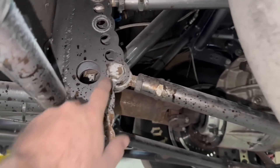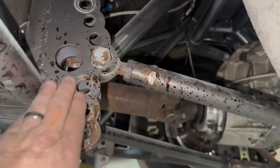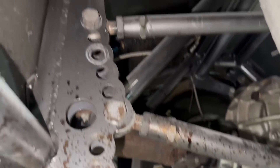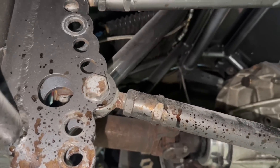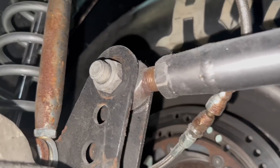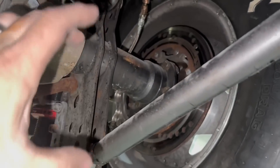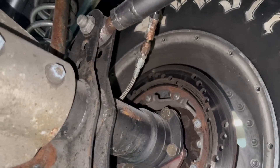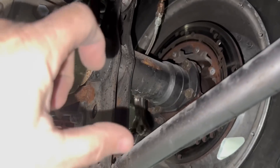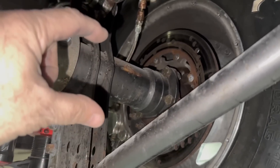You can see this is a pretty big drop — normally these are just over an inch apart, they're an inch and a quarter. These are the big bolts too. New stuff the bolt holes are only half inch so they're a lot closer, giving you finer adjustment. So we've got adjustments here and also back here on the body, or on the rear end — we have both body and rear end adjustment points. Let's take a look and see which works better: moving the upper bar down a hole or moving the lower bar up a hole.